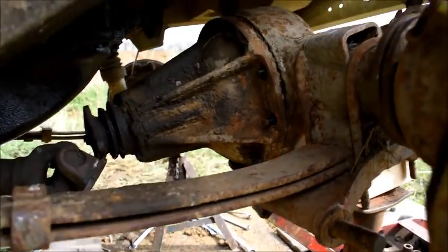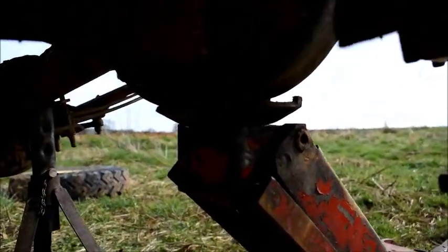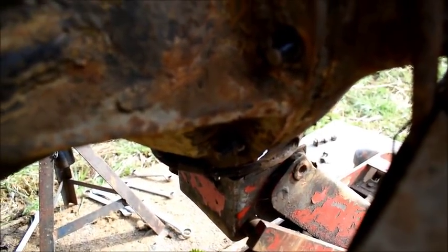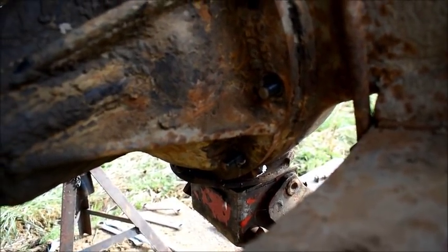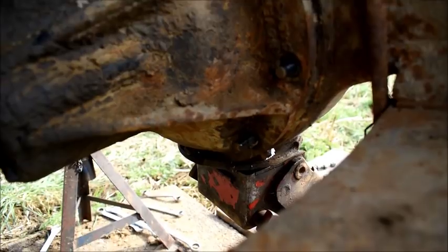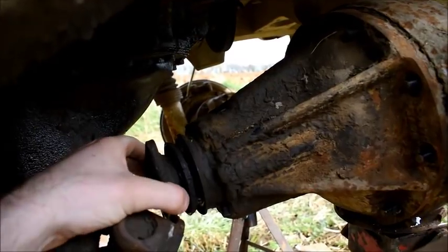I don't know if you can see this, but I've pulled the stub axles out and just removed all the nuts on the diff, so we went to slide the diff back. And already I've got a sign of what's gone wrong — you can see that we have loads of water dripping out rather than oil. So even though I thought I sealed my axles quite well, I managed to get water in, probably through the axle breather. I'm guessing water got in there and then I did my long journey to West Midlands — about 70 miles there and 70 back — just enough to knacker up all the lubrication in the diff and probably kill that bearing at the end there. You can see the movement.